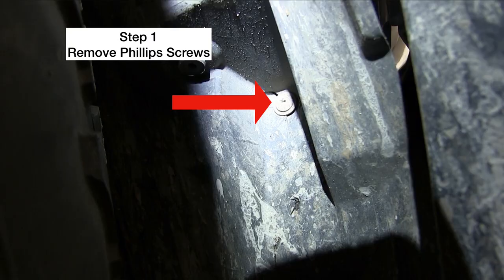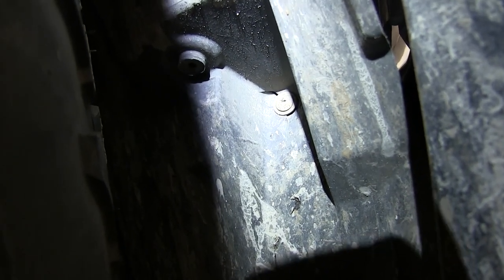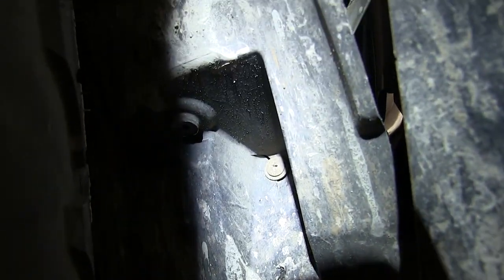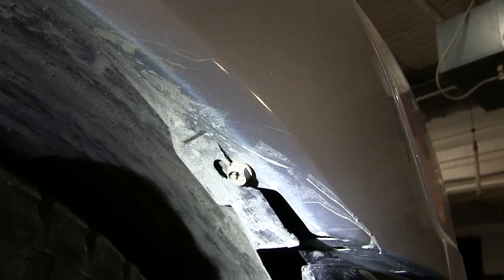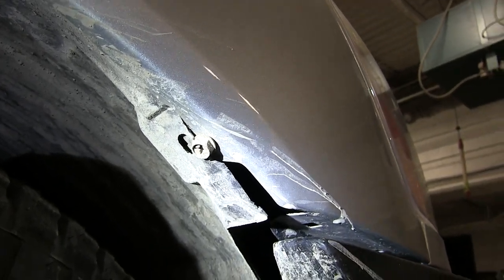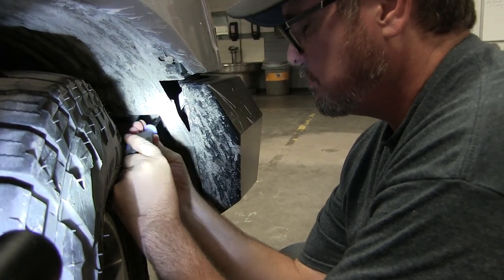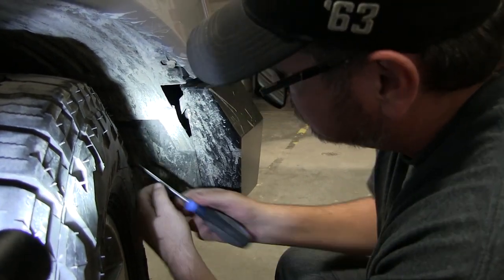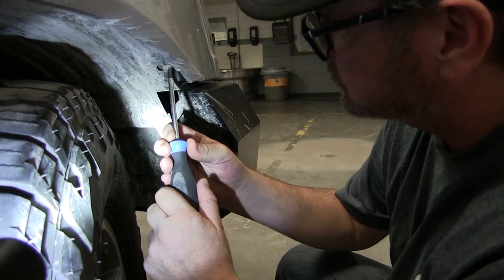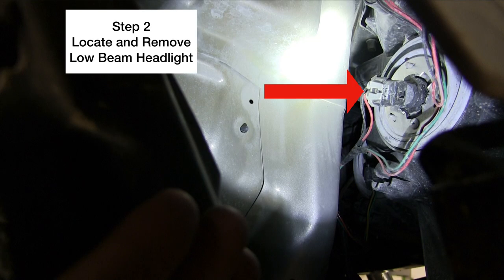On this Nissan Titan I'm going to replace the low beam. These go in your low beam in the headlight housing, and to do that there are just two Phillips screws to remove — a lower one and an upper one that's a little bit broken. Removing those two screws will give you enough access to pull that wheel liner back and get your hand through there. Another tip: turn your tire inward to give yourself more access to the screws.